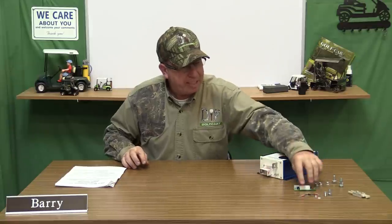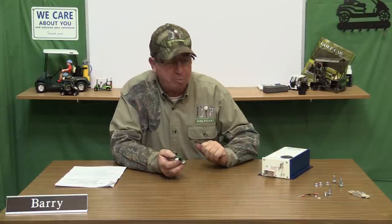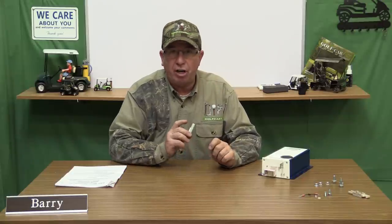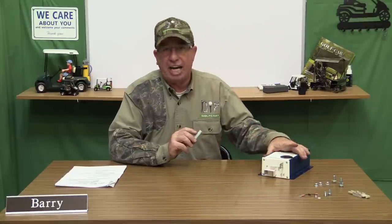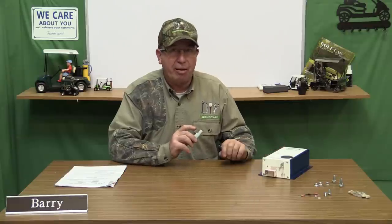This was ordered at the same time as the motor, so it's actually programmed to the motor, which is the best way to go. Now, before we get started putting this in the car, we have an adapter plate here that we'll be mounting — that goes across the little pins that stick out. We'll also need to run to the hardware store, because this controller is bigger than the OEM since it handles so much more amperage. We've got to purchase our own mounting bolts.